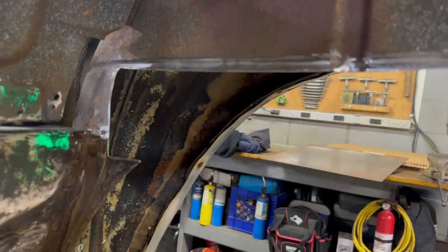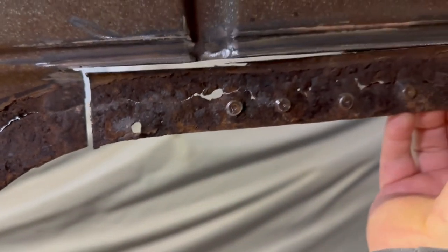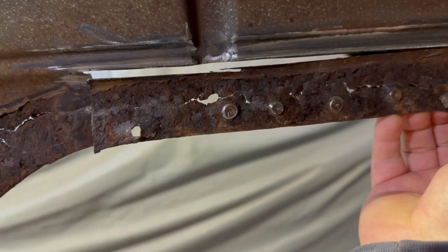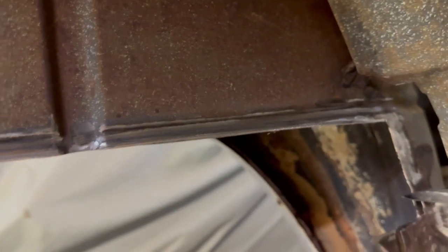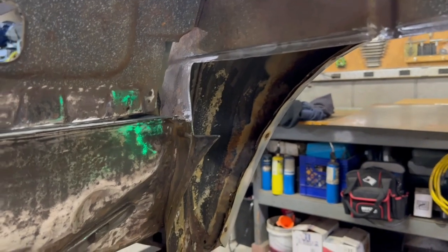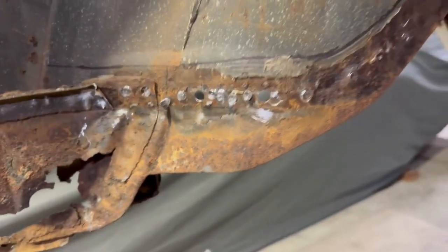Here's what I've done to come up with a plan for working front to back: I've cut out on both sides the portion of the wheelhouse — the inner wheelhouse — where the trunk floor tab spot welds. I figured I'm going to cut it right on that rib and make a new panel for this, and spot weld it in on both sides, nice and neat. Once that's all in I can work my way back to doing this piece and this piece — left side, right side. That's what I got done yesterday, and all this stuff piece by piece will just be eliminated.